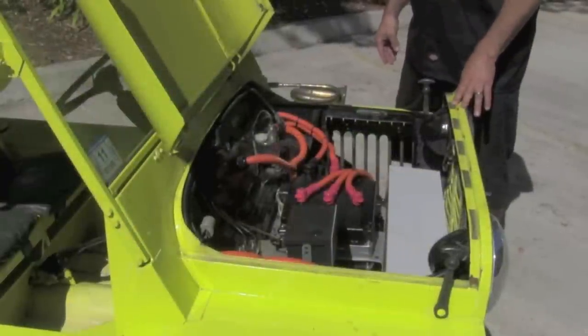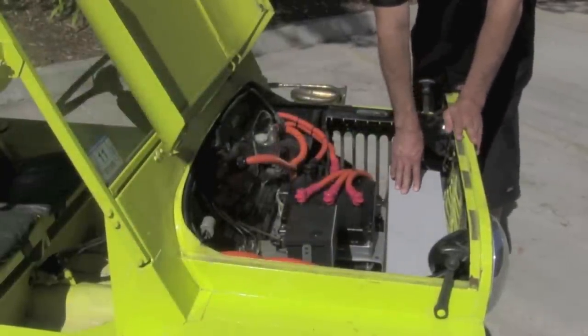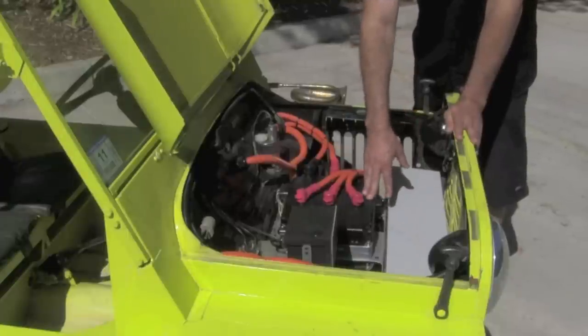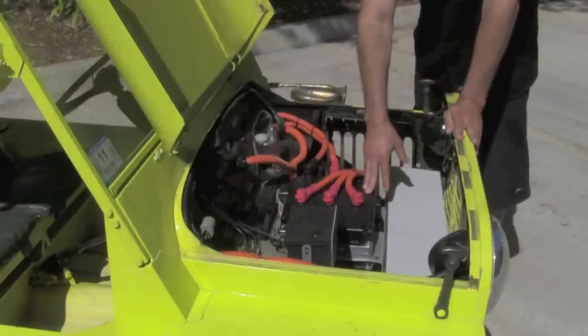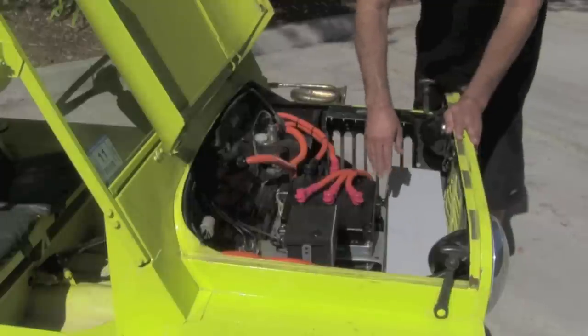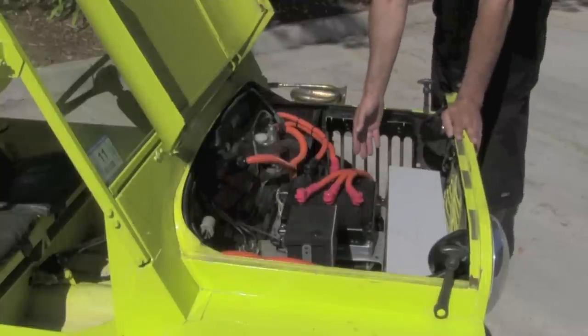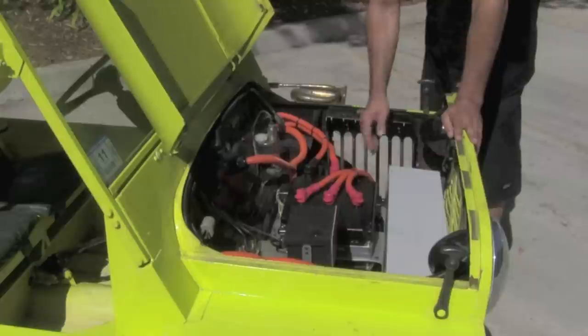Here's a quick overview of our motor compartment. Up front we have a little 10-cell pack. We have another 24 in the rear for a total of 34 cells — 11 kilowatt hours of energy — so it'll take this customer about 40 to 50 miles. We've got the Curtis 1238 7601, a wonderful controller — probably a little bit too much power for this, but too much power is not really in our vocabulary. We've got our water cooling kit over here, a little radiator down here, and we went direct drive with a Graziano 10-to-1 differential reduction gear up front.